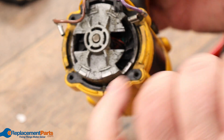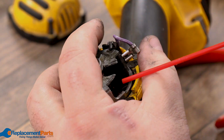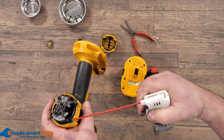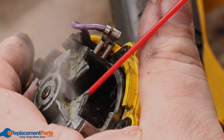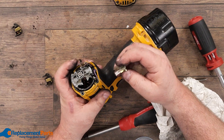The simple repair on this one is to use our compressed air and blow out all the dirt that's inside there, followed by our electrical contact cleaner to get all the remaining dirt out, and then insert our brand new brushes.